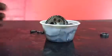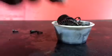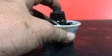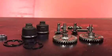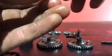Shake it all around, make sure every little part is covered and soaked in WD-40. Everything should be nice and shiny and cleaned up — no dirt on there. That's the last thing you want is dirt in your diff. Once you get everything out and cleaned off, you're going to use your silicone grease and your diff oil to rebuild it.